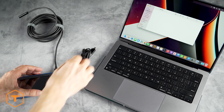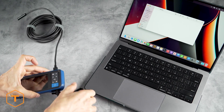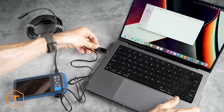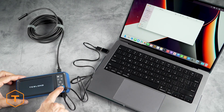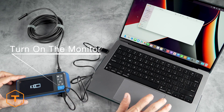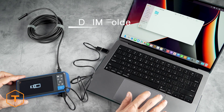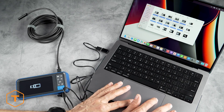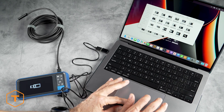There are two ways to move the files to your computer. The first method is to plug your monitor into your computer with the included USB-A to C cable and find the drive in your finder window. Note the monitor needs to be turned on to see the files on the computer — if you don't turn it on, all you will do is charge the monitor's batteries. Navigate to the DCIM folder and you will see photos and video from the device stored there, and can drag and drop them onto your computer.